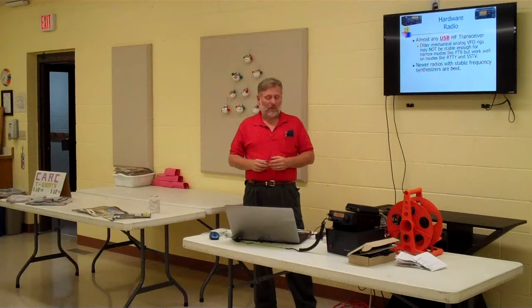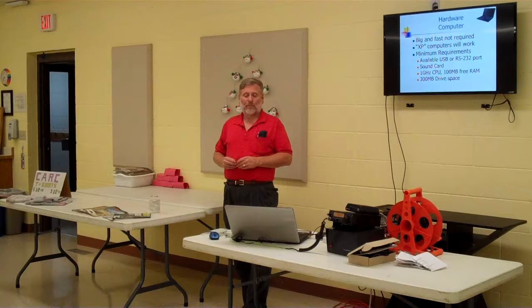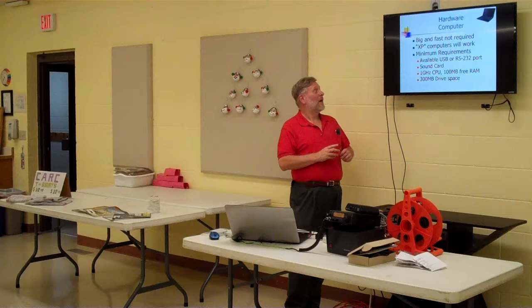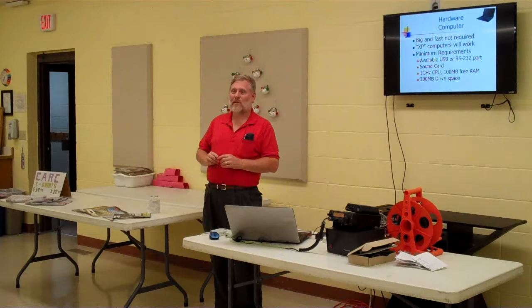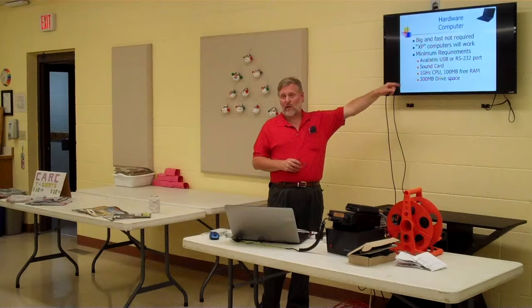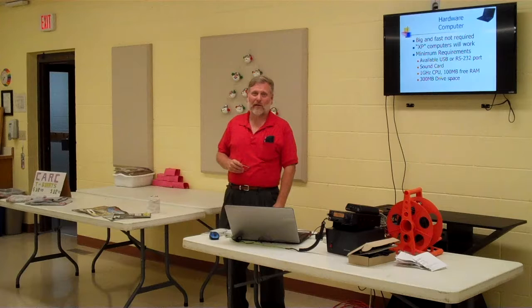For computer hardware, big and fast is not needed. You don't have to go out and buy a Windows 10 system for $1,000. The WSJT software that I'll be showing will run on an XP computer. And I believe FLDigi still runs on an XP computer, too. So you don't need big and fast. Minimum requirements is usually a USB port to trigger your push-to-talk, a sound card interface of some kind, and just a minimal gigahertz CPU. I think my smartphone has that in it, so you don't need a whole lot to run this stuff.